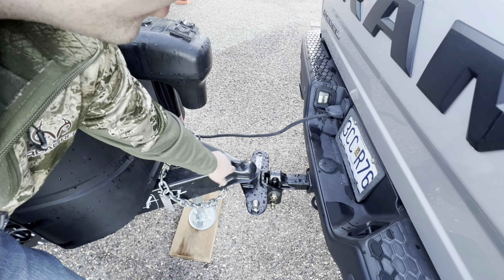You'll need to play with it a little bit. There are different formulas that some of these bars come with — Camping World didn't even give me the owner's manual for my bars — but from experience I know how to do this. Those formulas essentially consist of measuring the space in your wheel wells up front, then they factor in receiver height and tongue height to get you to your baseline. If you don't have an owner's manual and just want to wing it, this approach is going to get you pretty much where you need to go. We have it hooked up, so let's raise it up and show you what we're talking about.